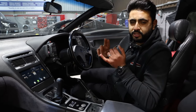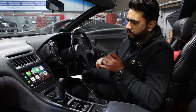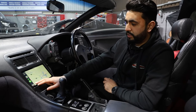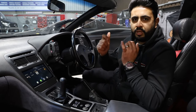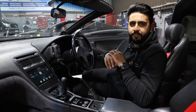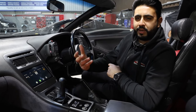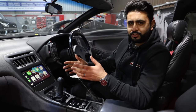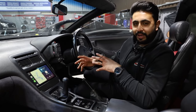We've got the menu buttons and everything all live on here. This screen also gives you the ability to have Android Auto and Apple CarPlay. You can see on Apple CarPlay — text messages, phone calls, maps — all on a really nice, clear 9-inch screen. The unit is really interactive and the screen is very responsive. Plus, we've also got DAB added in. We're using the factory antenna for the DAB with a DAB splitter — nothing added on the windscreen — retaining the factory FM antenna and converting it to also function as a DAB antenna, while the original FM is retained as well.